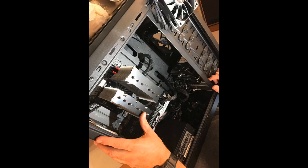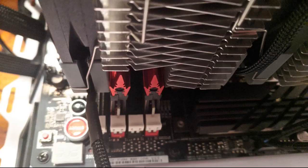Installing the middle fan is indeed a little tricky, especially installing with Mobo still in the case as I did. I found it helped if I gently pulled the fan clips away from the cooling tower while lowering the fan. In my excitement I initially installed the center fan backwards. I was initially disappointed that temps did not improve at all and thankfully decided to double-check my install work.